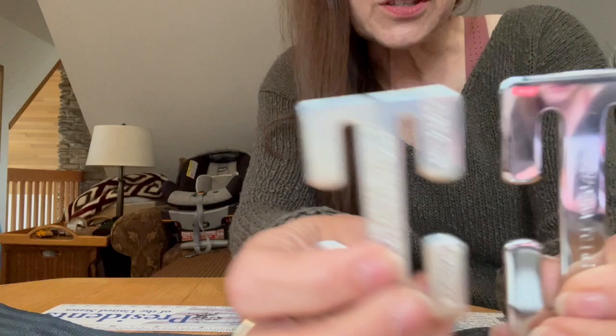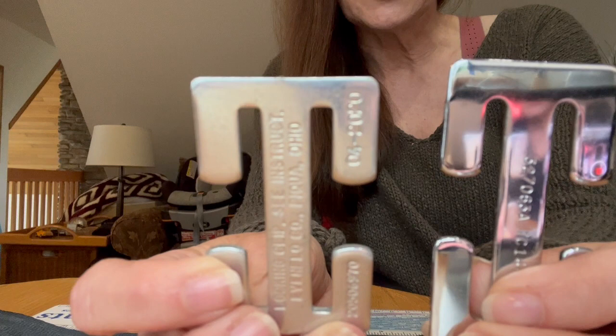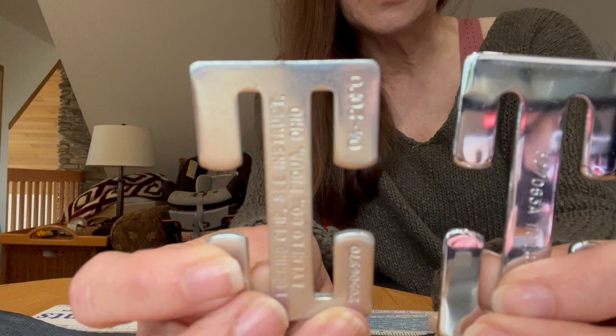This clip on the right is a locking clip. It comes with car seats or you can get it from the manufacturer. It's used for one specific purpose: when you have a lap and shoulder belt with a retractor that only locks in a crash and the latch plate is free sliding. It holds two pieces of webbing together as a pre-crash positioner so that when a crash happens, your lap belt stays at a nice short length to hold the car seat.